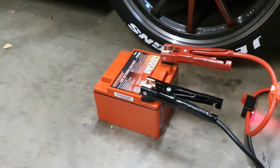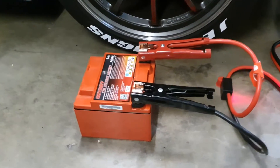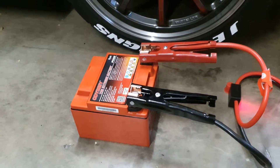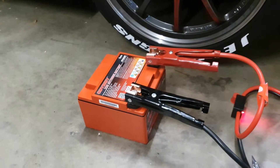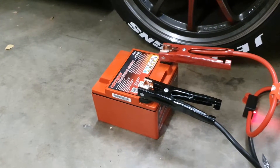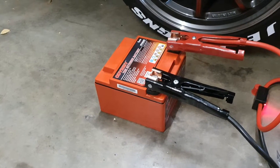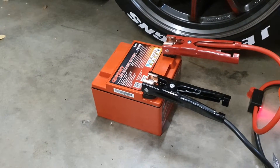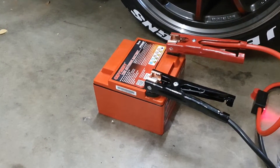I have a parasitic draw in my car and I recently installed a battery isolator onto the negative terminal. What that allowed me to do was to essentially open up the circuit so that nothing could draw power from the battery when I turned the car off. The problem was, even though I was taking a charger to the battery in the back of my Evo, I'd go to charge the car the next day and even though it was reading 14.4 volts on my Torque Pro app, the next day I'd go to start the car and even with the battery isolator I couldn't start it.